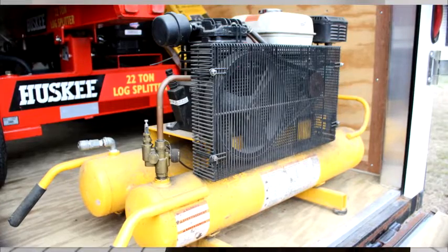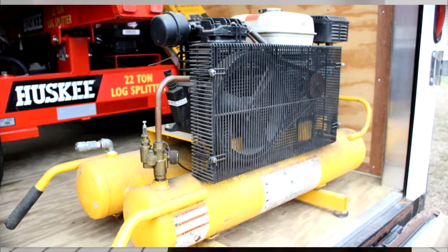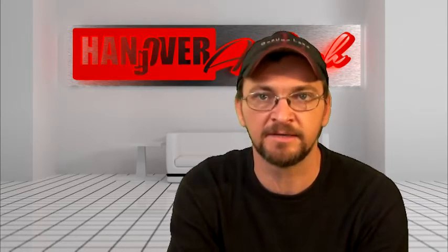It's not going to drive a touch-up gun all day long. You've got to listen to your compressor and kind of work around your compressor's willpower, so to speak. If you want to paint a whole car and you want to use a full-size HVLP, you're going to need a substantial compressor. This is the one that I use — it's gas-powered. That makes me portable, so I can go wherever I want on a couple gallons of unleaded and spray whatever I want, wherever I want.